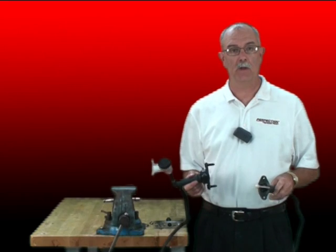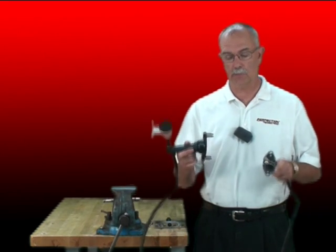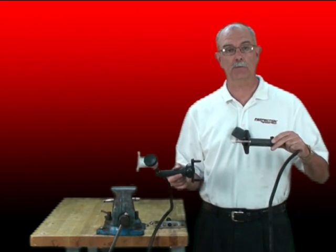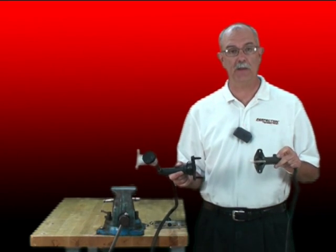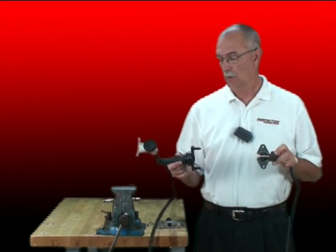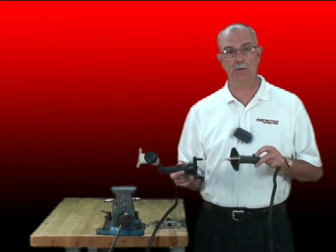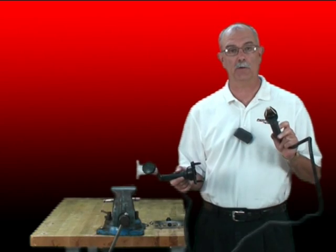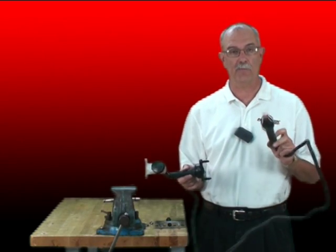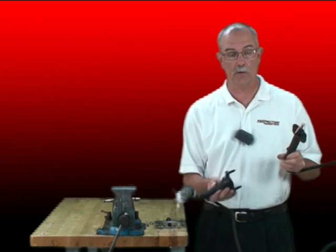Welcome to Perfection's Clutch Training Lab. I've got a clutch master cylinder, line, and external slave cylinder with a bleed screw. I'm going to demonstrate a procedure to bench bleed this on the bench. We're going to put DOT 3 brake fluid into it, start a basic bleeding procedure, and then prove that it's bled before we install it in the vehicle and drive the truck or car away.